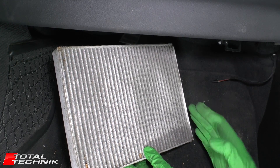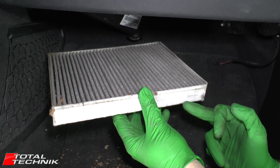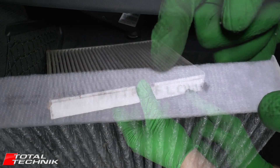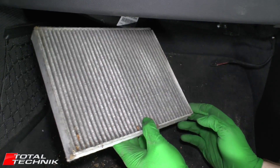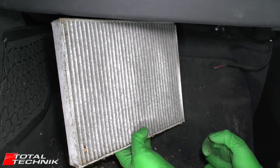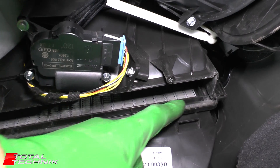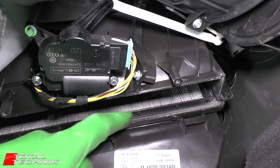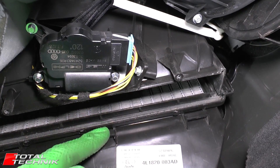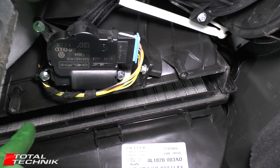Once yours drops down, don't take it out straight away — take a quick note of the bottom where you've got the part numbers. You'll see a marking that says 'airflow' with a little arrow pointing downwards, so that arrow is effectively pointing back in towards the engine. Also be careful of the rubber foam seal around the edge — it ensures an airtight seal. Make sure that when the filter drops down you don't pull the seal out, and likewise when you push the new one back in, make sure it doesn't pop out. Keep an eye on it and ensure it's properly inserted all the way across.